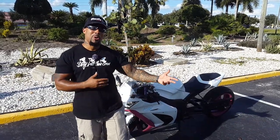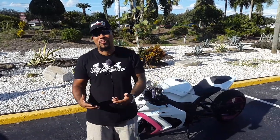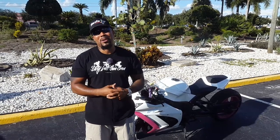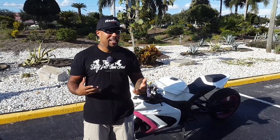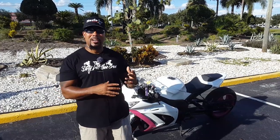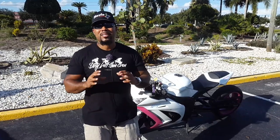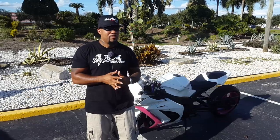The final con is funny because it was also one of the pros: the bike won't wheelie. That means you can't have the same fun you'd have on a stock wheelbase bike. Don't expect to throw on a swing arm extension and do the same wheelies you'd do on a stock setup. Now, I have seen drift bikes set up where they're not slammed in the back — those people specifically set their bikes up for that purpose, so they can do it because the setup supports it.